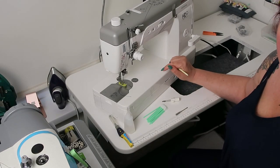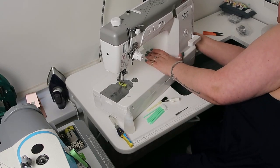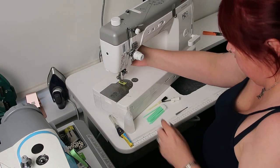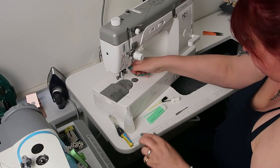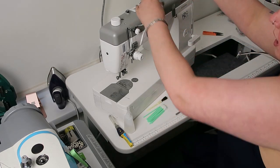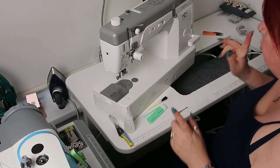I'm going to give Jill a bit of a clean out and a little bit of TLC because she's not been playing ball very much lately. I'm going to start by unplugging from the mains - it is switched off anyway but I always just unplug from the mains. I'm going to take my presser foot off and take my needle out as well. I always just tend to replace the needle whenever I've done a clean out, just so that I know it's been done.